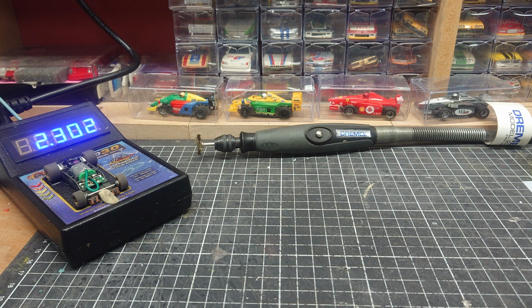It's still on around about 23. The dyno is an indicator of how your car's running, but it doesn't necessarily tell you how it's going to translate on the track. I honestly believe the best way to use the dyno is just as a tool to give me a number, to tell me how it's spinning. Mid-range is where I chase most of my speed, and like I said, at the lower volts the dyno gives me a really good indication of how that's going.